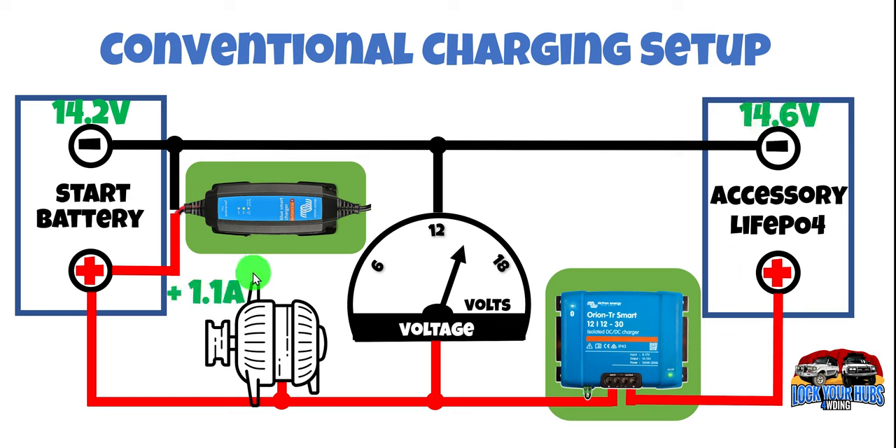Well it could be, but probably not, and here's why. We're only getting 1.1 amps out of that charger, but our DC-DC charger operates at an efficiency of 87% at 30 amps. If your battery's down a bit it's going to be sucking down every one of those 30 amps, and it'll be taking out of the start battery 34.5 amps — which is a little bit more than the 1.1 amps being thrown in by the AC charger. You'll end up with a net loss of 33.4 amps coming out of that start battery. Next time you want to start it up? It's either flat or it's suffered enough from sulfation that it's stuffed. That's the problem with charging your start battery with AC or solar when you're running a DC-DC charger that just operates off threshold voltage.